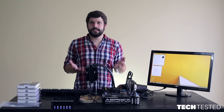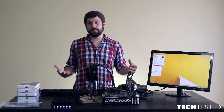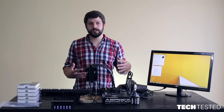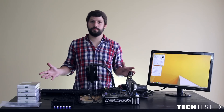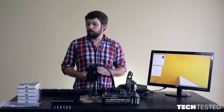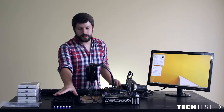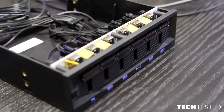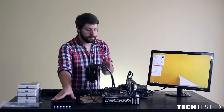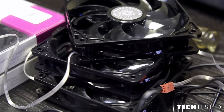When I ran my preliminary tests at home, I used a hodgepodge of different fans. This became a problem because some fans were more pressure-optimized than others and actually caused one fan to stop spinning altogether, losing all the pressurized air I wanted. So I needed all the same fans running at the same speed. I went out and got a NZXT fan controller that controls up to six fans. We'll also have the exhaust fan on the motherboard at full speed, giving us a total of seven fans in our setup.